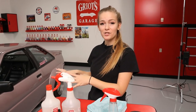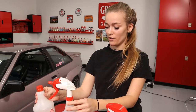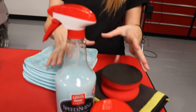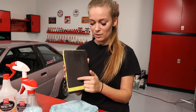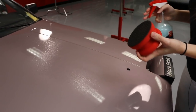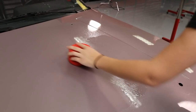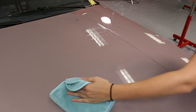Now that we've removed above-surface dirt, we're going to come in with our decontamination tools. There are two types: mechanical and chemical. The chemical options are foaming surface prep, which removes light contamination, and iron and fallout remover, which is an iron and ferrous particle remover from paint and other surfaces. We're going to move to a mechanical decontamination tool. Instead of pushing contaminants into the surface, it pulls them out of the paint — they're collected in the speed shine between the channels as you run it across. Light pressure, just glide it across the surface, and you can hear all that contaminant. Usually three to four passes and a wipe will suffice.